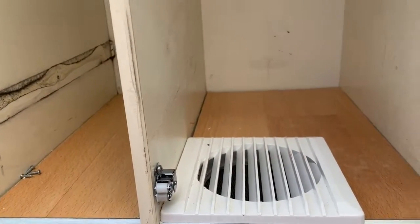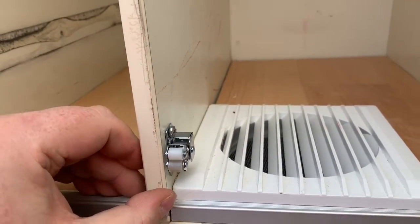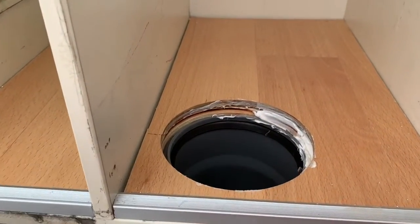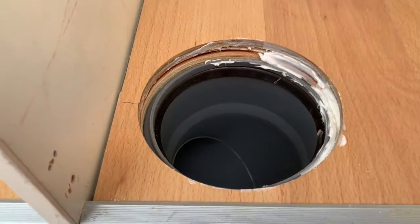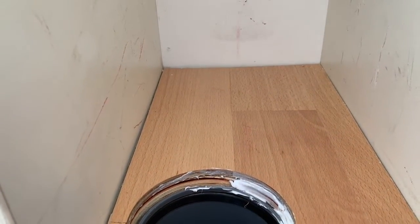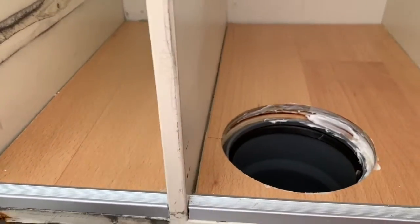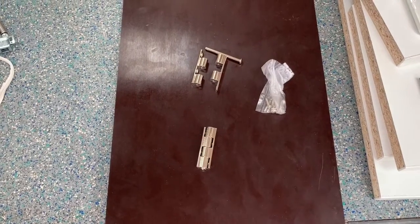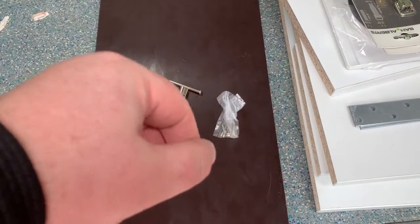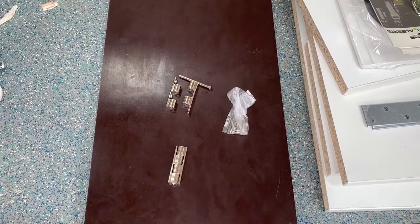Originally I wanted to fasten the front panel of my gas compartment with furniture snap latches, but their holding force is too weak and the panel doesn't hold properly. So I've come up with a different solution and am unscrewing those parts again. I've also removed the grille again — you can now clearly see the installed 90-degree angle pipe, so that no moisture thrown up by the front wheel can be flung upward into the interior of the gas compartment. I'm now sealing the corners with silicone. While the silicone cures and dries, I'd like to attach hinges to my gas compartment hatch so it can be opened by rotating and also closes with more tension and pressure than just the furniture snap latches you saw earlier.